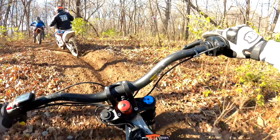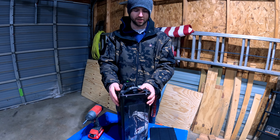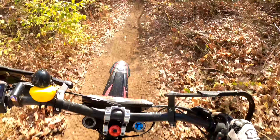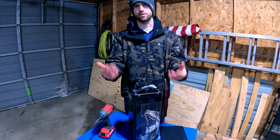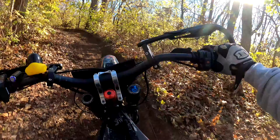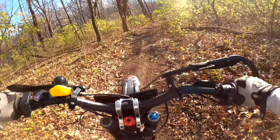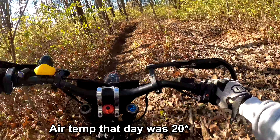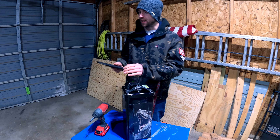A lot of you have been asking why this battery didn't charge in my last video where I raced my Sur-Ron and Talaria. Here's the backstory: I raced on Saturday and used 65% of it, leaving 35% remaining. I took it home, plugged it in, and the charger said it was fully charged a couple hours later. But when I got to the track, my KO controller showed it was still at 35%. I contacted EVMX and we discovered it didn't charge because the battery was under 32°F (0°C).